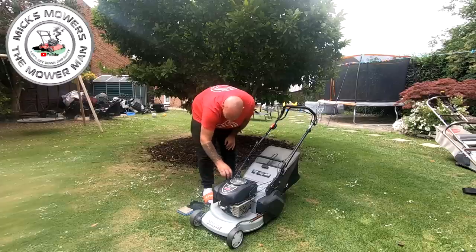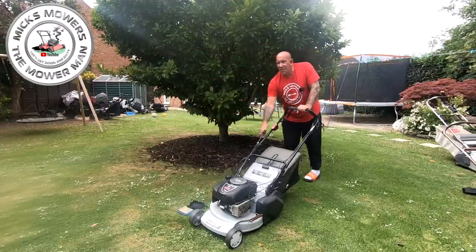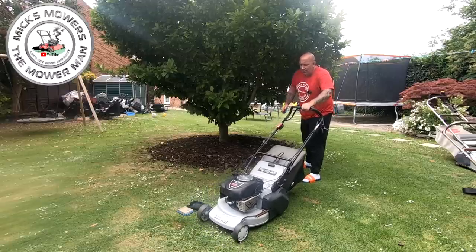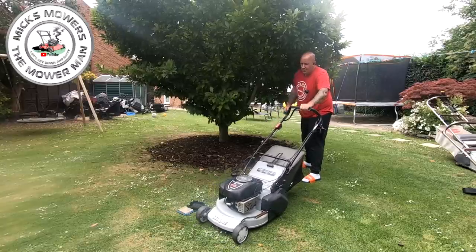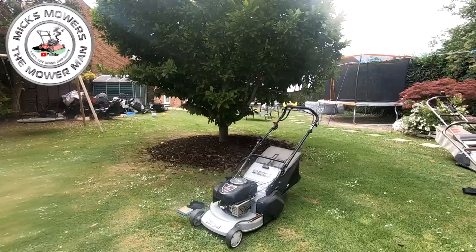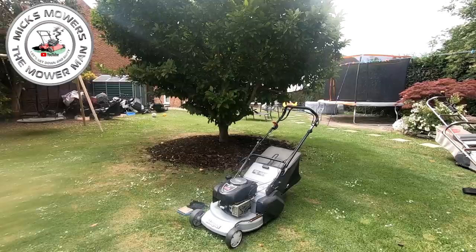There is fuel in the system — I can confirm that. So let's start it up. As I say, I've already had it running once but then I couldn't restart it. I don't want it to go — see that? Nearly. So I'm now going to go and get a new plug. The plug looked fouled. I'm going to get a new plug and a bit of carburettor spray. It should be firing and working but it's not. It's currently got a Champion spark plug in there, which is a good plug, but maybe the plug's just failed — maybe it's just done its hours.